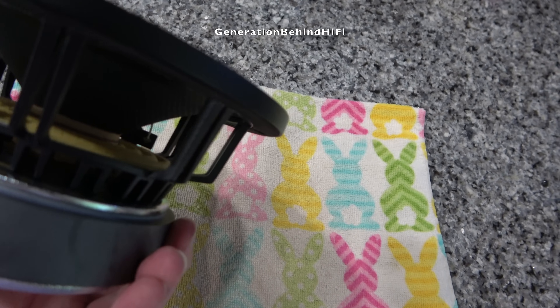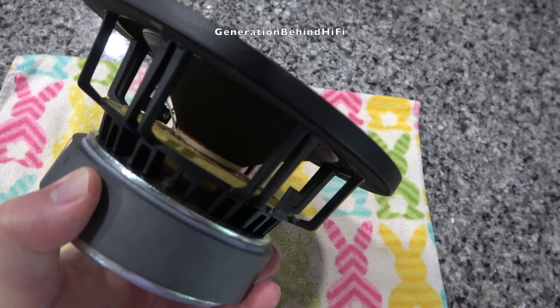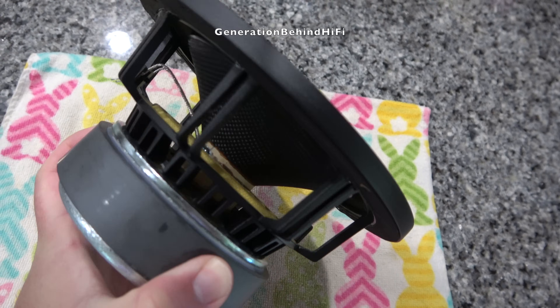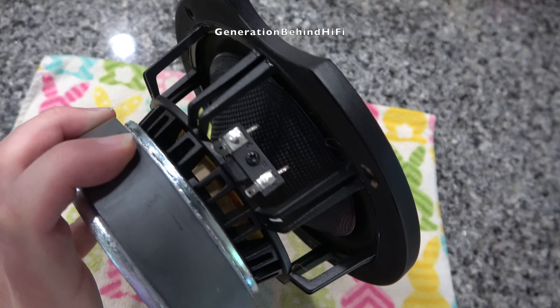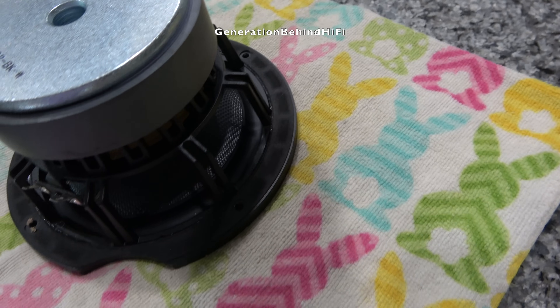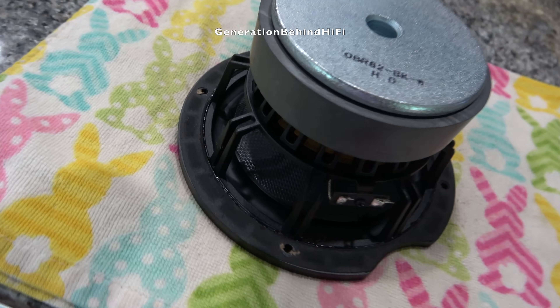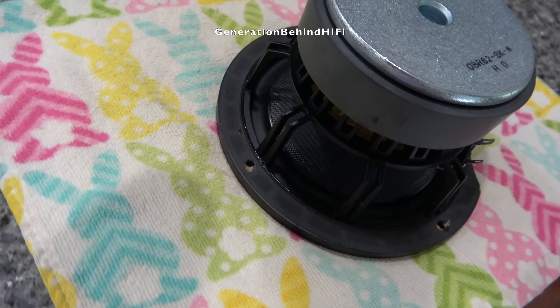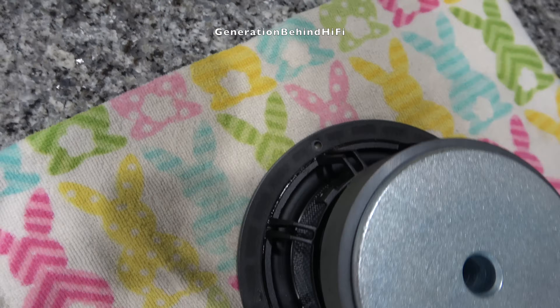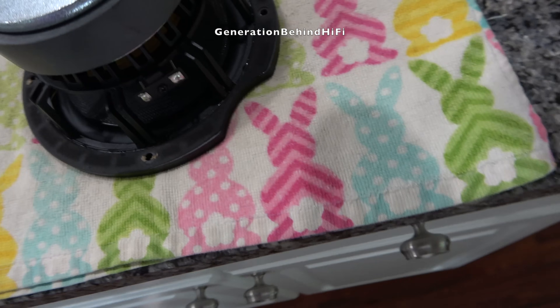In my opinion Aramid is a premium material and isn't cheap, so I was surprised to see it in a pair of bookshelf speakers that are this affordable. And the premium materials didn't stop there. Elac is using a cast speaker basket instead of the typical stamped steel variety I see in this price category. Cast baskets offer better damping and are substantially stronger than stamped steel baskets. Even a pair of $799 KEF Q350s use a stamped steel basket for their Uni-Q drivers. With Elac, it appears you get quite a bit of value for your hard-earned dollar.